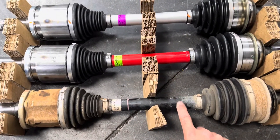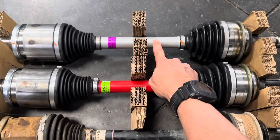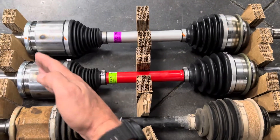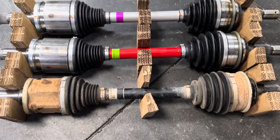So this is the standard traditional black axle that comes in most of these. This is the off-road axle. And this is the TRD kit axle. With that being said, these two are both great options if you're going to lift your truck and you're going to go over two and a half inches. This axle is not a good option over two and a half inches.